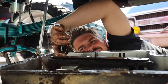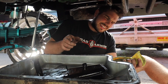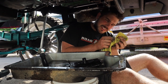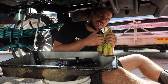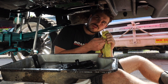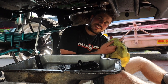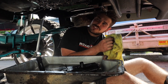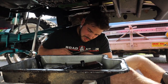There's a good amount of sludge down here on the magnet, but nothing crazy — it looks like normal clutch material. When I blew the tranny out of my 06 Ram, you could just feel it and you knew. But this is weird. A lot of people on the forums talk about the feed bolts being loose or falling out — in that case it gives you no feed pressure at all, so the tranny won't act as it should.